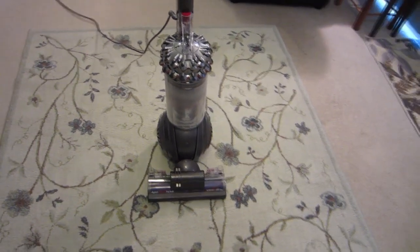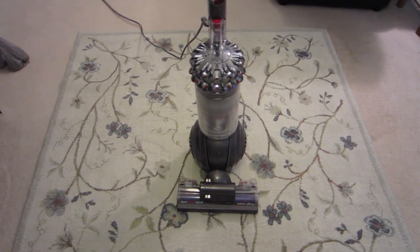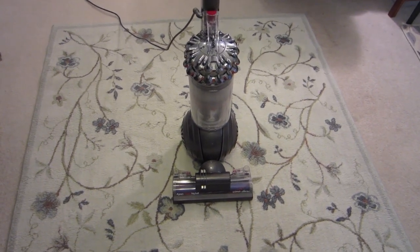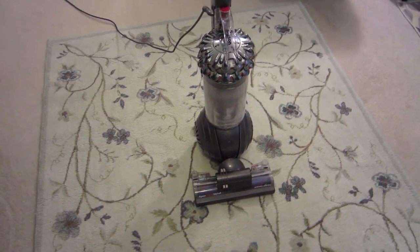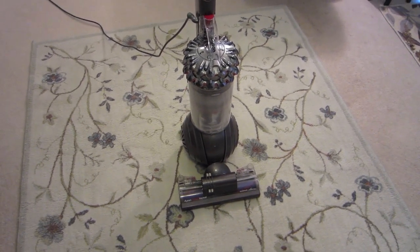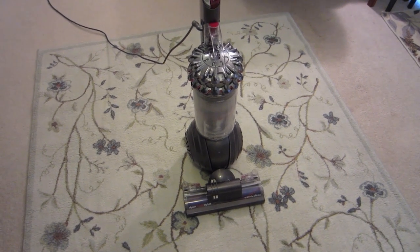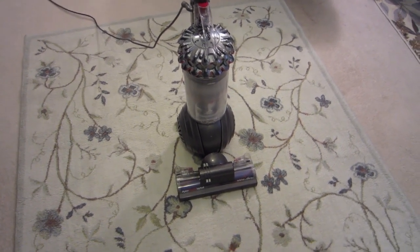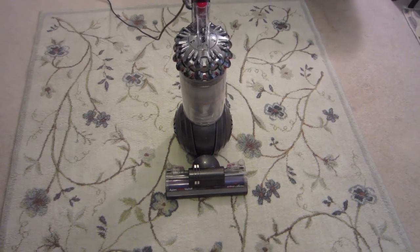To go on to a more positive side, the first time I took one of these apart I was very impressed with the fact that it actually uses screws throughout, especially in terms of the cyclone for disassembly. That's something that hasn't really been done by Dyson since about the DC-25. Most of the newer ball models, things like the DC-33 that are still more based on legacy platforms, still have the screws inside them, but pretty much everything else in the newer ball range has had finicky-to-disassemble canisters held together entirely by plastic friction-fit snap-on fittings, which are just horrible for long-term durability if you're going to disassemble it - which, honestly, you probably should.